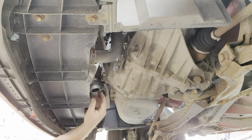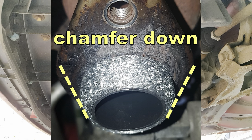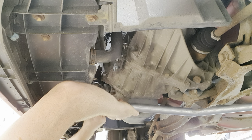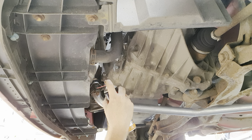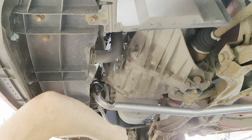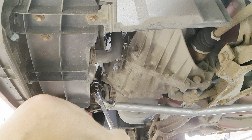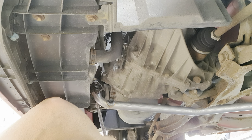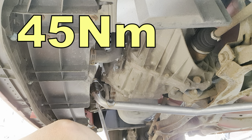I've not done the clamp up fully tight just yet — I'm going to move to the front now. Back at the front, temporarily drop the centre section back down to the floor by disconnecting the hanging point, and fit the gasket to the end of the catalytic converter pipe — you might have to knock it on. Bring your pipe up to the union and put the two screws back in with the springs. A little lube will help them turn on; tighten into place with your 14mm socket, doing about three to five turns per screw and then moving to the other so it goes on evenly.